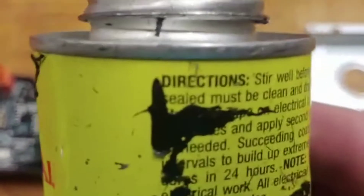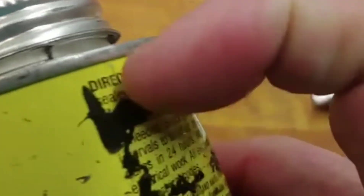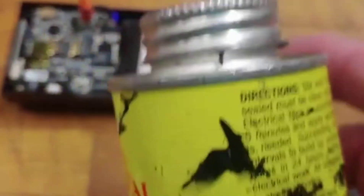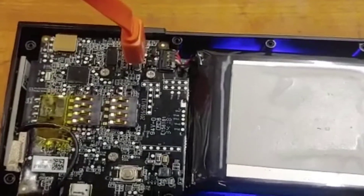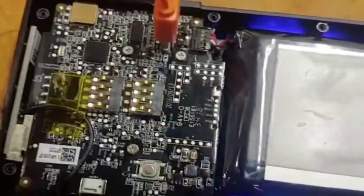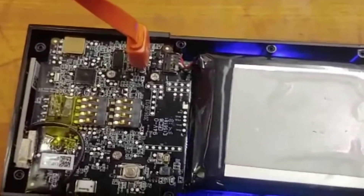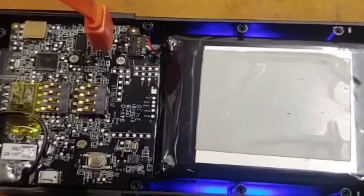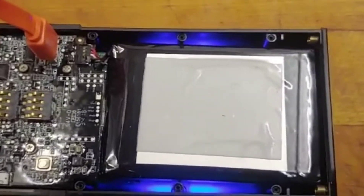It's really flexible. You can see it almost peels off, but the good thing is that on something like this it will bond to it and protect the circuits from moisture. Of course I don't put it on the contacts themselves — I put it mainly on the battery terminal. I'll also clean the charging port, which was a little oxidized because I had to wiggle the charger to make it work.